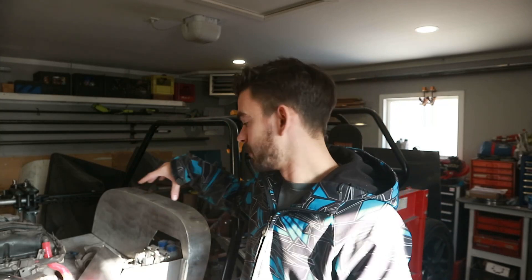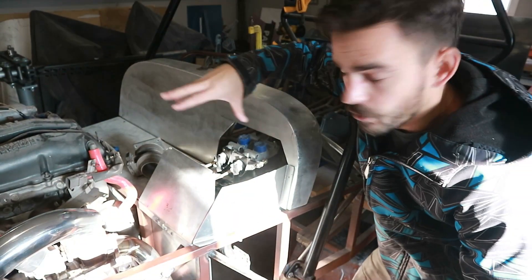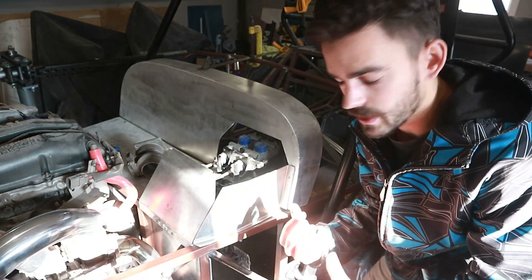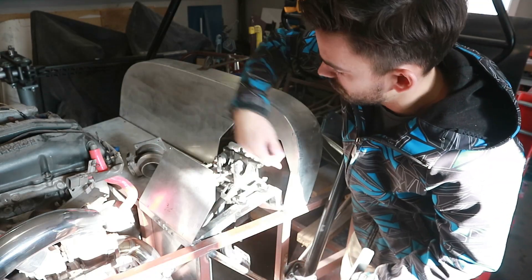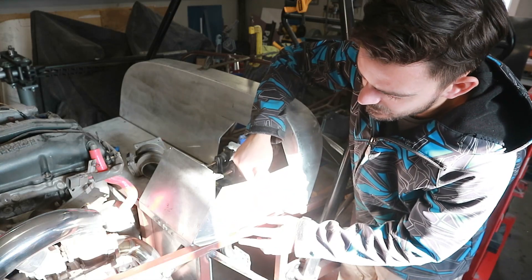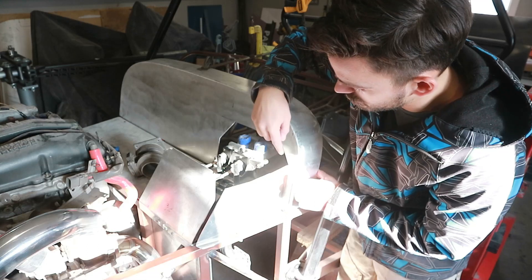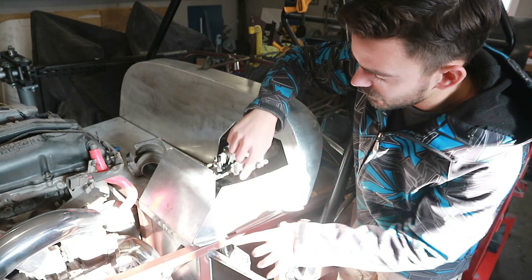We are working on the firewall. There was this kind of box area right here that we had to cut out for the pedals, because the pedals are going to live on the inside of the firewall. So we have to build an enclosure around this to seal them up. I took the panel that we cut out and mounted it up here with just two rib nuts on the front, and I've got started building this kind of side panel here. It'll screw onto the firewall here, we'll weld it onto this guy here, and then it sits on the chassis at the bottom.